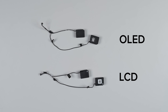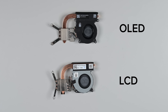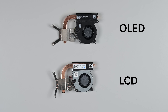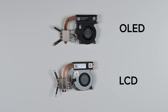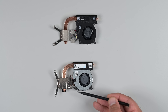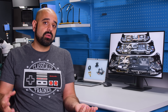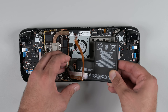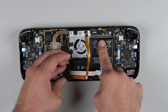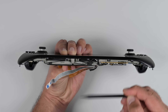The speakers appear to be unchanged, and I didn't have any trouble swapping these parts between devices. Thermal management is always top of mind for Valve, and in the latest LCD revision they flipped the fan over. The OLED model keeps this design, and the fan on the latest LCD revision is compatible with this new OLED Steam Deck, although the screw placement on the copper heat pipe has shifted slightly. The 50-watt-hour battery is just slightly too thick for the LCD Steam Deck, so you can put the 40-watt-hour battery in the new OLED Deck, but you can't go the other way around.